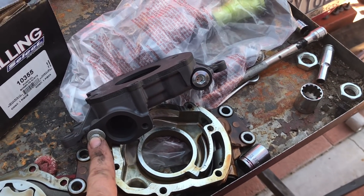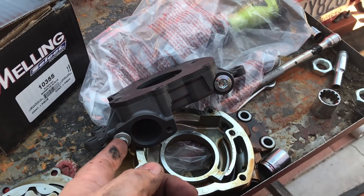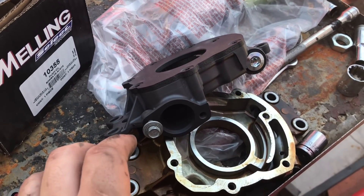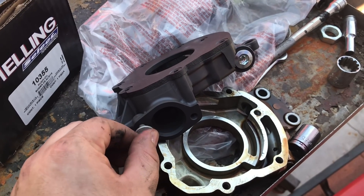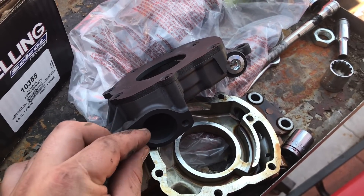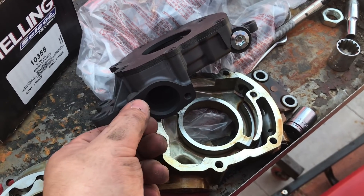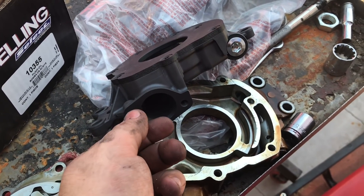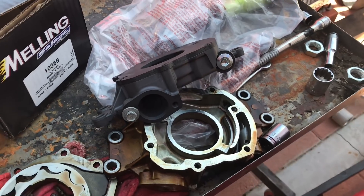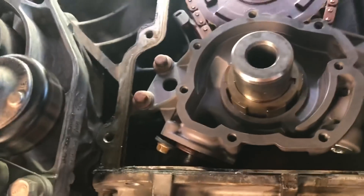That was my mistake — this is a 2007. On the older ones, I don't know exactly which years, but if you're not able to move the bracket, you would have to put a washer and bolt on it. If you are able to move it a little and can see the little tab, then you would have to grind it off — just make sure you don't go too deep because if you hit the pickup tube that'll be a big problem. Sorry again for that misunderstanding.